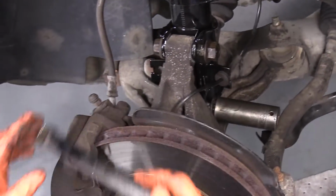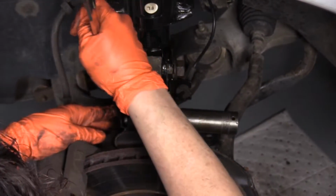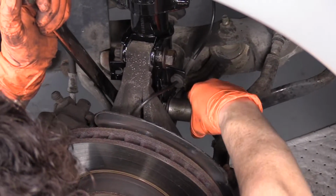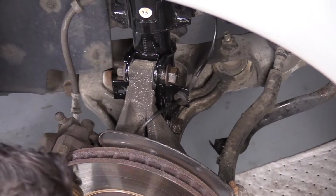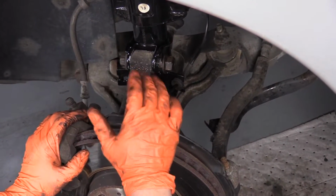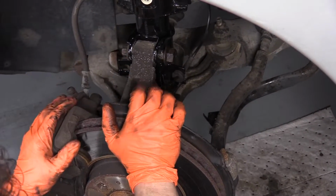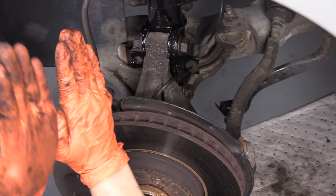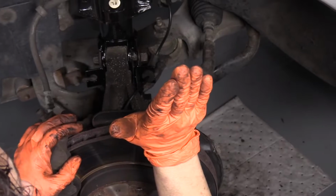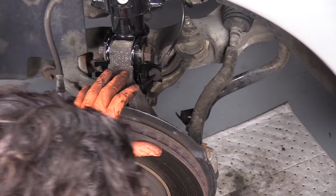Now when I'm tightening a strut, because it's got to get lined up anytime you take a strut out, whenever I'm tightening one up, I like to put the camber, even though it's not slotted, there's still some movement to it, and I'm going to tighten both of these with that pushed in all the way. So if this is the front angle of the rotor, I want that knuckle pushed in all the way this way, not left like that. So just like that. That's how I'm going to tighten this down.